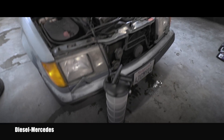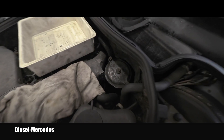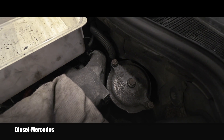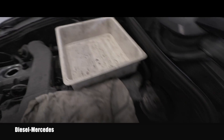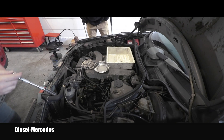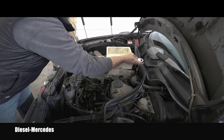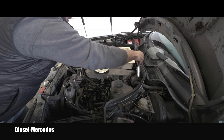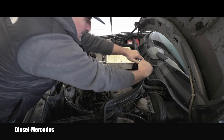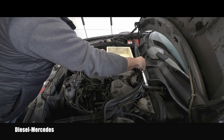Since it's slowly filling, we can move on to the other part of this job — removing the engine oil filter, which is right here. I brought some rags already for the spills and I have a little pan for that filter element. You can probably hear the vacuum from the evacuator, but since we're here, let's deal with this. There are two nuts and one center bolt rod — all of them are number 13 sockets.